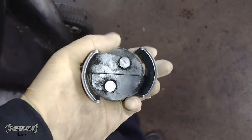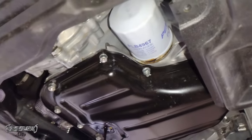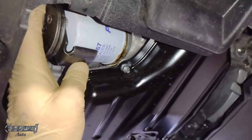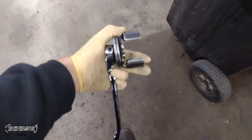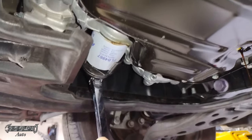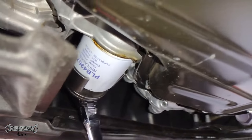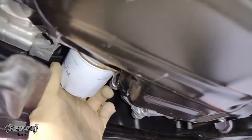Go ahead and get the drain plug out — the old gaskets can be kind of stubborn to pop off. For the oil filter, I have an oil filter tool that goes right on here. Put your ratchet on the tool and it'll twist and unscrew the filter. You could also use a band wrench — I'll link one below. It's a little circle that goes over the filter and you pull it backwards to remove it.